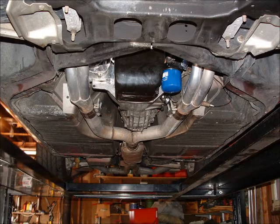So fasten the oil filter by turning clockwise onto the threaded stem of the engine block and tighten it hand tight. Once it is hand tight, twist it an additional half turn to ensure that there will be no leaks.